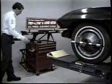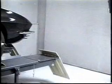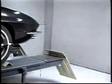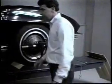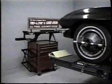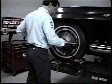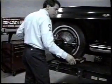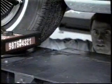Adjustments are made if necessary, and these are done before moving to the toe part of the alignment. To measure toe, the technician locks the steering wheel in the straight ahead position and hangs the gauges starting with the rear. He hangs the rear gauge and sets factory toe, then hangs the laser gun, sets factory toe, and points to the rear and across. The technician reads the scales and makes adjustments as necessary to complete toe.